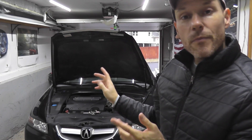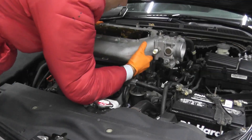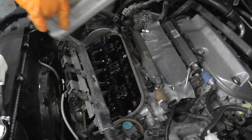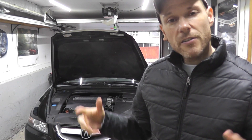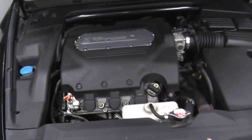Around a month ago we replaced the valve cover gaskets on this 2006 Acura TL. I mentioned I discovered this because the front wheels were just being caked with oil residue. After doing that repair and cleaning the wheels it was much better, but I'm still getting some residual burnt oil on the front wheels. This is something I completely overlooked — let me show you what we're looking at.